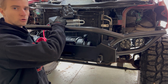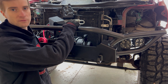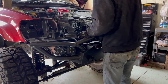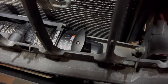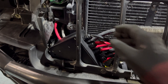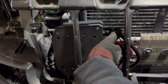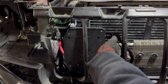I went ahead and disconnected this control box so we can relocate that, mount it in a different location, and save some cutting I'm going to have to do on the grille later. The first spot we're going to have to cut — and if we're lucky, the only spot — is a notch right here for the clutch release and engagement. The best solution for this controller is basically just flip it around and then run some zip ties around the header panel right here to hold it into place.